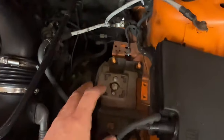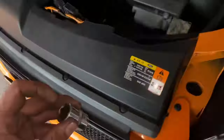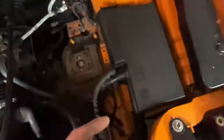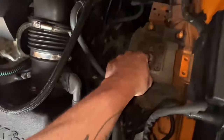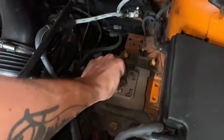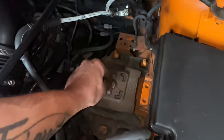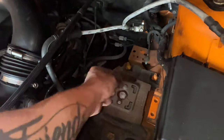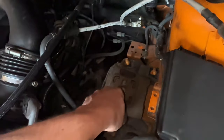The tray's taken off. This bolt here — it's an 18 mil — and you're going to need a big breaker bar to crack it because these engine mount bolts are on there tight. Remember: when undoing this with the jack underneath, once you've cracked it, the bolt should start coming up. If it looks like the gearbox is dropping, re-evaluate your jack position. You want the bolt to come up, not the gearbox to drop. The engine mount is now off and the gearbox hasn't really gone anywhere because I've got the jack under there.